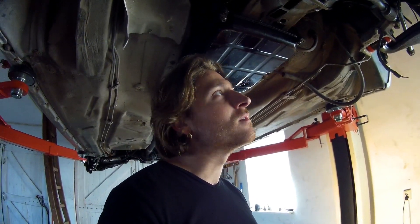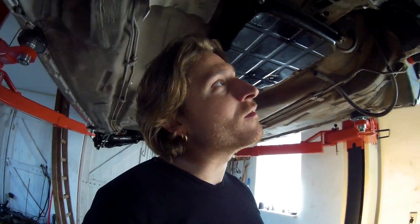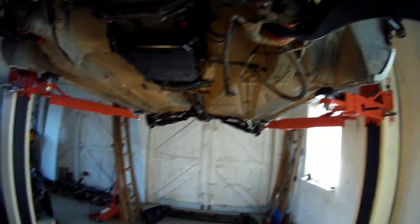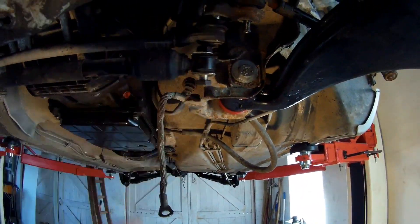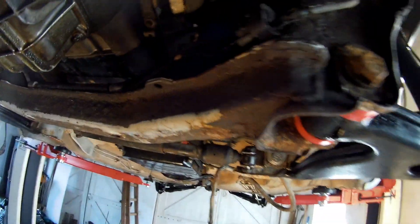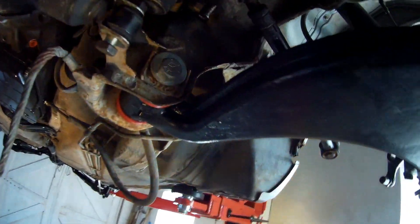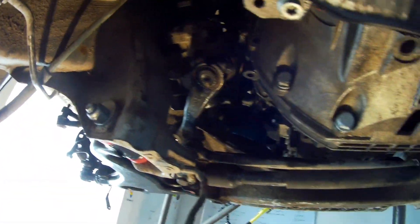The 500 and 400 model W124 steering boxes are just rare and cost like ten times a secondhand one of a normal W124 model with an inline-6 or inline-4 engine. So how did I find a solution for the steering box? As you can see, this one is loosened up but it's all like original. The problem in the beginning was that I didn't have any clearance between the steering box and the exhaust manifold, but there is space between them now.